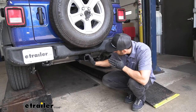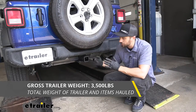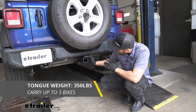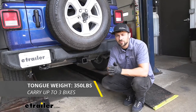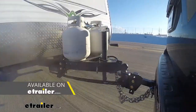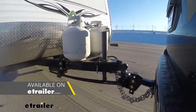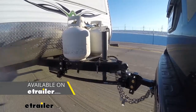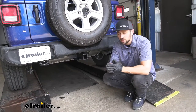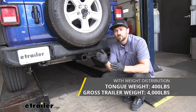This particular hitch has a 3,500 pound gross trailer weight rating, which is the amount we can pull outward on the receiver tube. It's also going to have a 350 pound tongue weight rating, which is going to be a downward force on the receiver tube. Now if you are towing a trailer, you may be interested in a weight distribution system — these are a really helpful tool while towing, so I definitely recommend you check out our selection at eTrailer. If you are using one of these systems, the capacity of our trailer hitch actually increases to 4,000 pounds for the gross trailer weight rating and 400 pounds for the tongue weight rating.